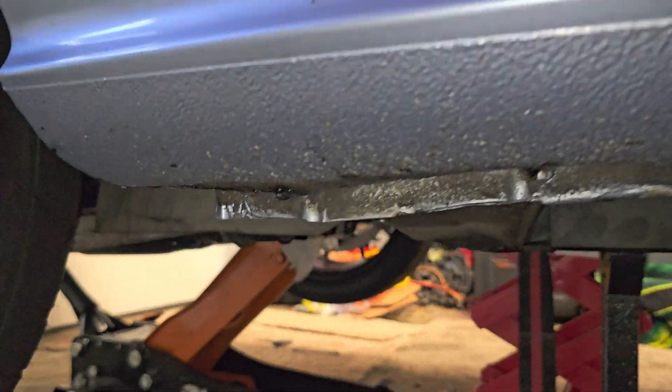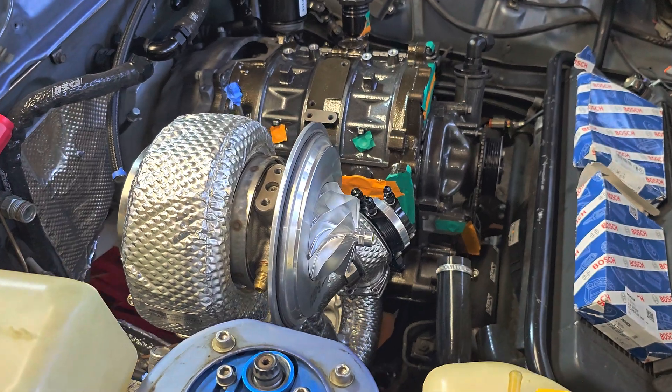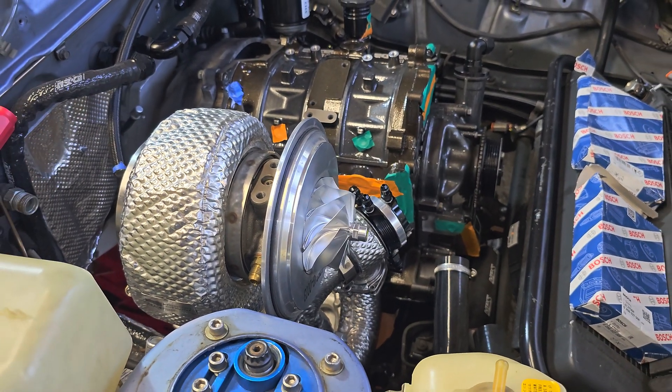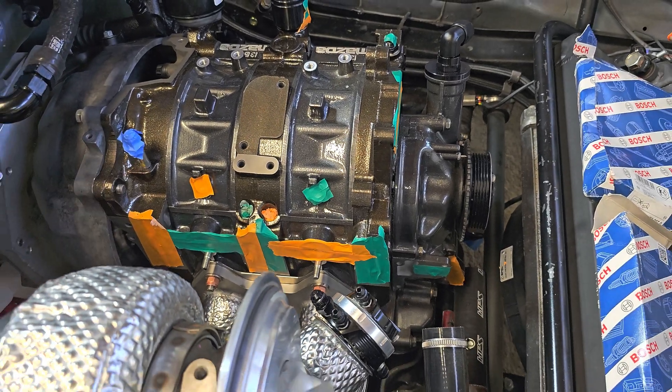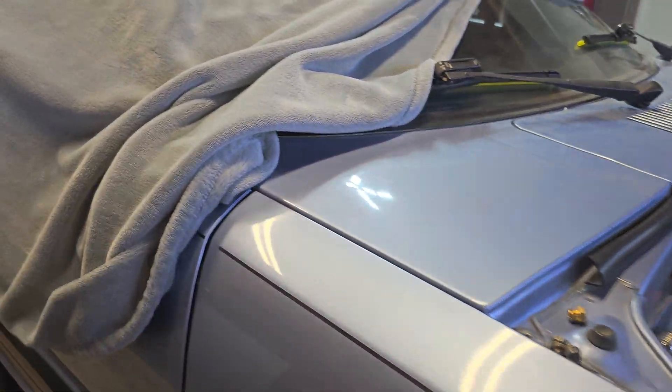Again, in my scenario I want quiet but I want power, and it's honestly kind of hard to get both. The older approach would be to have a straight-cut gearbox, or a beefed-up helical kit from something like OS Geiken — great brand, but not really what you're aiming for. If you're trying to push like 35 pounds of boost through a semi-PP bridge port motor, as much as you could build a factory transmission, it would not handle it.